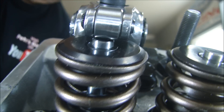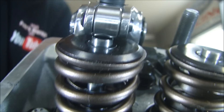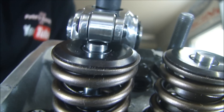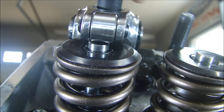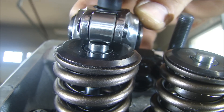Let's turn this over a couple of times — take the valve open and close — and back to the base circle on the cam. Now let's take this off and see where our roller ended up.